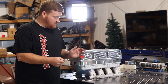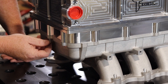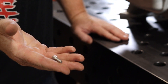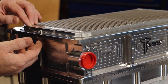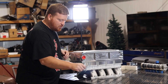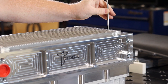Save the four medium fasteners that the spacer was pre-assembled with — all of the medium length fasteners are to attach the bottom portion. They'll either go up through into the cooler in the front or down through the side into the lower portion of the intercooler. The short fasteners are for the lid mounting to the upper part of the intercooler — three in the front come from underneath, and the sides bolt the lid down to the core from the top. It also includes three long fasteners for the three holes in the back that run from the lid all the way down to the base.